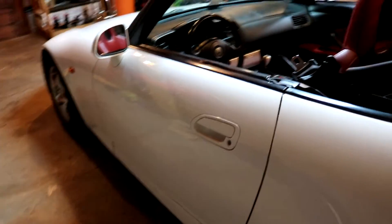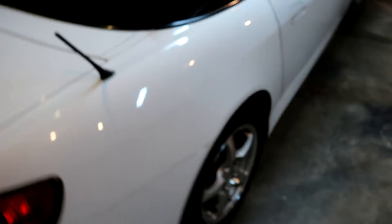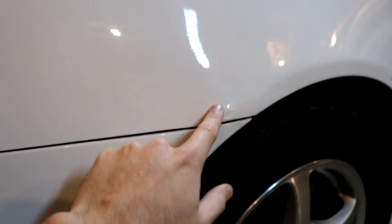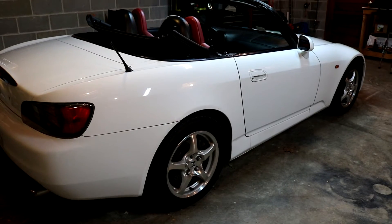The paint itself is in pretty good shape. There's some small imperfections - it's a 17-year-old car that's actually been daily driven for a while. It's developing little signs of rust right around the fender. There's a black trim piece which I think is just trapping moisture. Unfortunately the other side is starting to show signs of rust. It's not structural, so I'm not going to get screwed like with the truck - at least I hope. You can see how it's just starting to bubble here. That's not good. We got to fix that - that's going to probably be one of my first projects. I'm going to have to take this bumper off, strip this down, probably strip it up to here to make sure there's no rust left over. Just surface rust - we'll take care of that so it does not spread, because I've seen some of these where the entire fender is just rusted out.